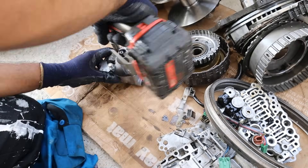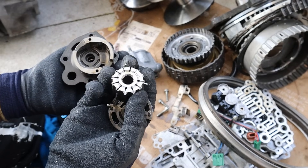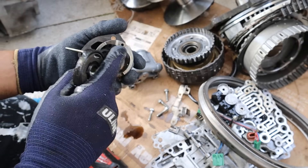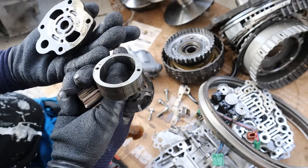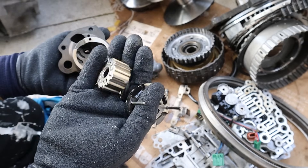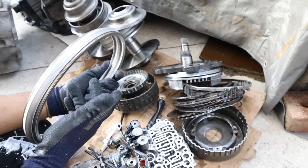Let's take a look at the oil pump real quick. This is a vane style oil pump — you've got these little vanes that rotate and create fluid flow inside of this eccentric hole. This one does not look like it's worn out too much or that much debris was passed through it. There's a bit of wear on the housing but the vanes themselves all look intact.